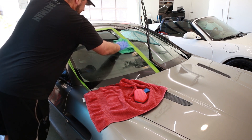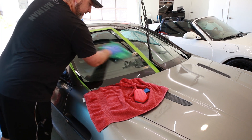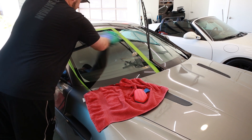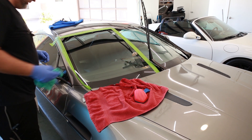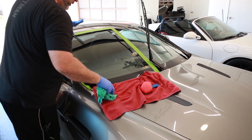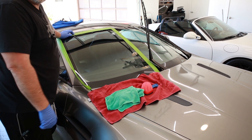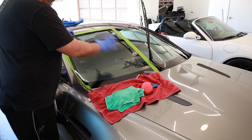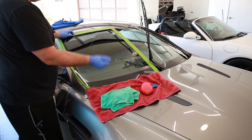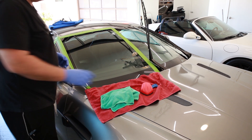Let's say you don't have a clay bar — it's not a horrible idea to use a Magic Eraser. That is an invaluable detailer's tool. I know people will probably scare you into thinking it's the most coarse sandpaper out there, but it really isn't. It comes in handy on many occasions. Otherwise you could also try quad-zero wire wool. Some people use that, but I found it gave me micro-abrasions on the Porsche. Wet wire wool starts to rust pretty quickly and I think it might have just been too abrasive, so I've removed that from my windshield regime.